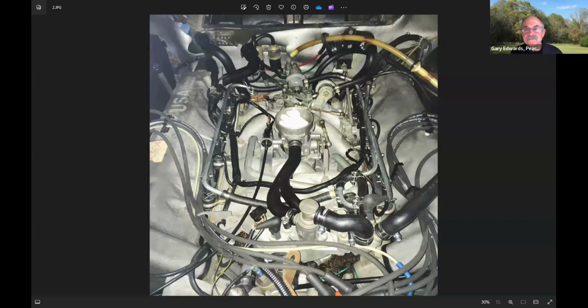Well, I had the intake manifold off, and so I sat there with brake cleaner, carburetor cleaner, a bunch of Q-tips, and a big vat to contain all the stuff that drips off of it, and just meticulously went through every nook and cranny until it didn't have any dirt in it anymore. And I cleaned the valley too. You can't really get to the valley with the intake manifold on the car. I found a 3/8 inch drive 6-inch extension in the valley, and I put a derusting agent in the valley as well. But I was very meticulous about making sure there was not a spot of dirt left on it. Now, I also point out the FME cover that I use, foreign material exclusion cover, in here to make sure nothing falls in. So I hope that answers that question.